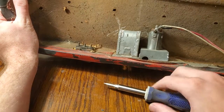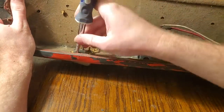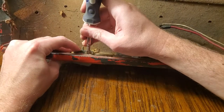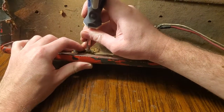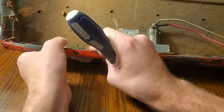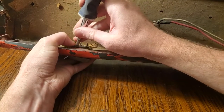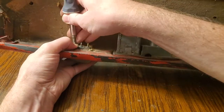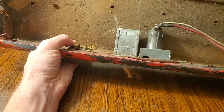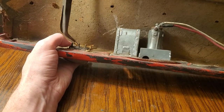So how you get the switch out is you want to push on these metal tabs here while pushing down on the switch. And this will help get this out of its metal frame that it's in. And then also, of course, get this one in the back here, which is always the hard one. Sometimes you can help things out with some pliers.